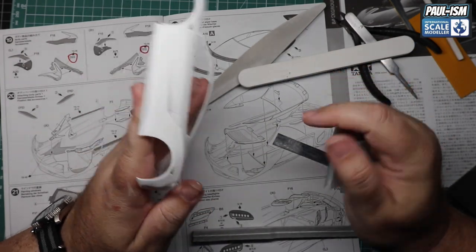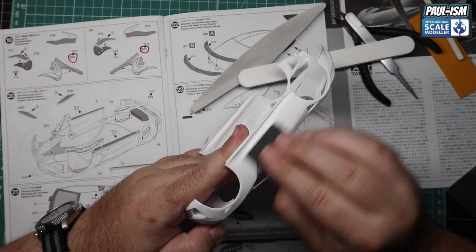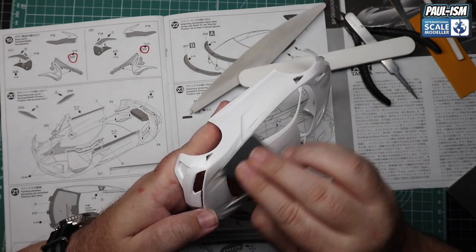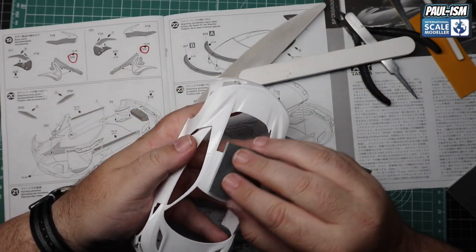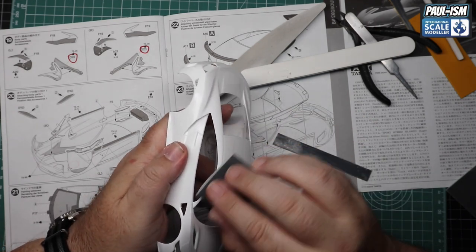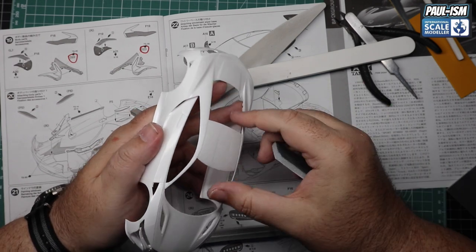As you can see, it's a sponge pad. And work my way around the body. All I do is dull the plastic. I don't want any shiny plastic at all. This leaves no scratch marks or anything on there at all. It just dulls all that plastic nicely and keys it for our primer in a bit. Also removes all those surface imperfections, any glue marks, anything that shouldn't be there. And again, yeah, a little 5-minute run around with this.